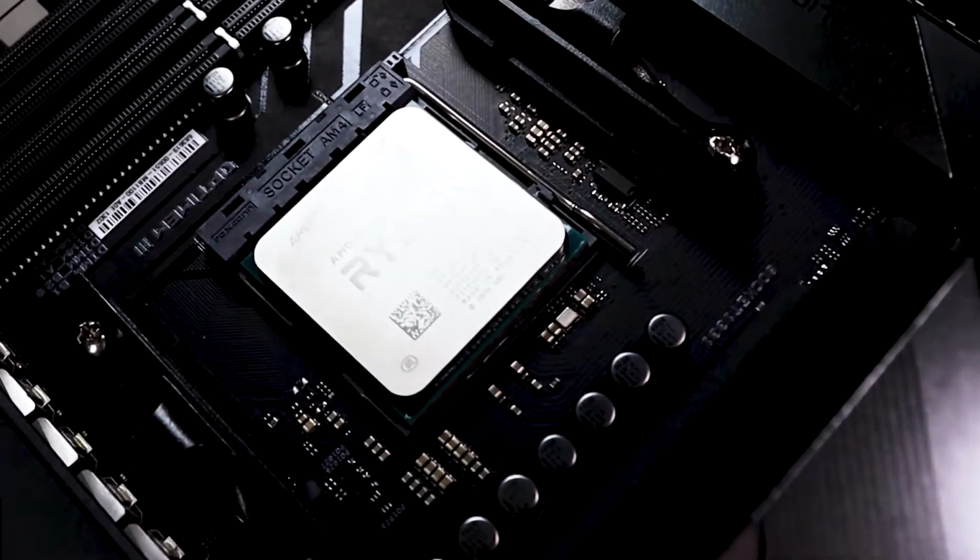We picked this processor because it's actually a really good kind of price to performance and actually has slightly better gaming performance than the Ryzen 9. Mainly because the less cores it has, the easier it is for it to stay under control when being hit by thermal load. It also has slightly higher boost clocks when overclocked, and since we are water cooling on an X570 motherboard, we're gonna be just fine.